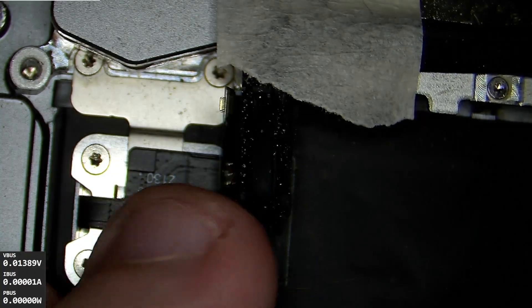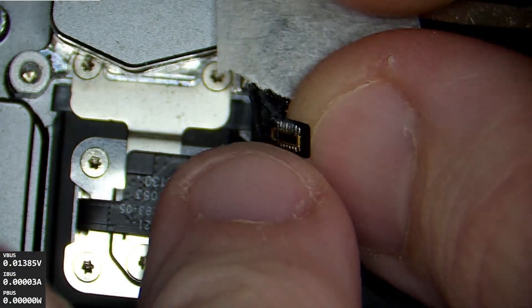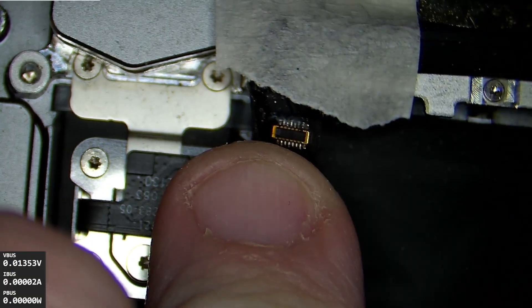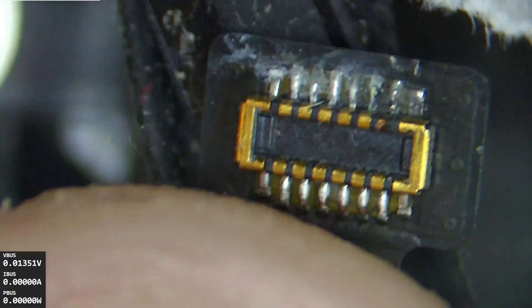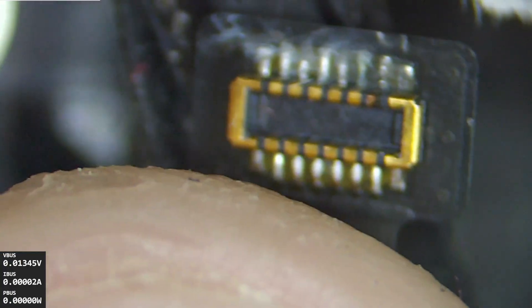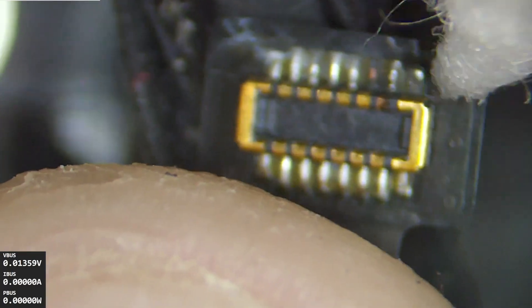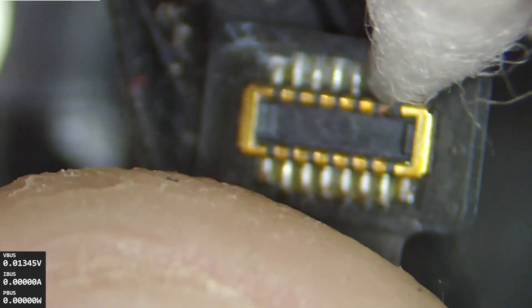So we had this burned connector for the Touch ID. And of course you do have some corrosion on the module. It's kind of hard to hold back here. It doesn't really look too bad. We can see kind of that pin is charred. I think I can just clean this with a Q-tip and it'll work. If not, maybe I actually have a spare Touch ID connector for this that we can use. But I just want to make sure those pins aren't shorting together — assuming that 16-volt pin just shorted to ground. I think that kind of looks like it might be gone.